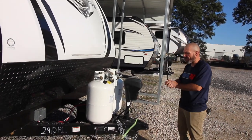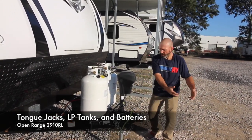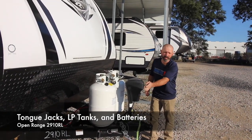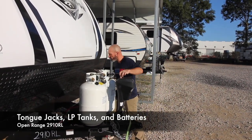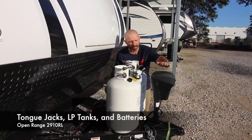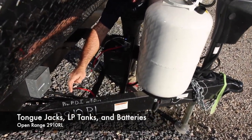On the front side you're going to have the electric jack. Here are your two switches. This side is just a light that's going to help you hook up at night when you're hooking up to your hitch on the truck. This side is simply going to be your up and down. Here is going to be your manual handle. Most of the time if your hitch stops working, remember you have an inline fuse here. Most of the time that is the problem — that's a 30 amp.